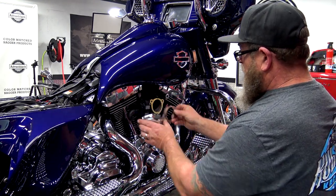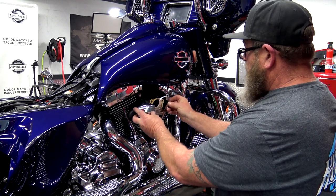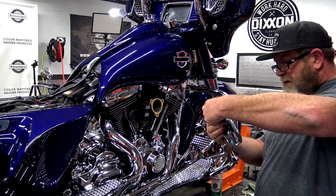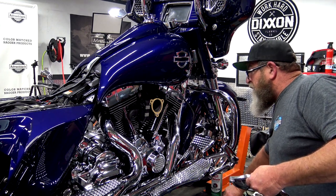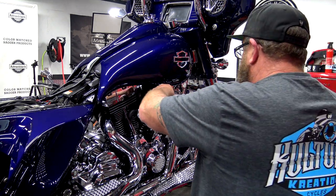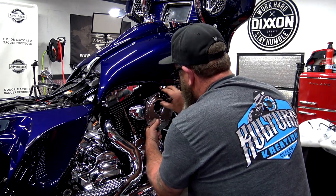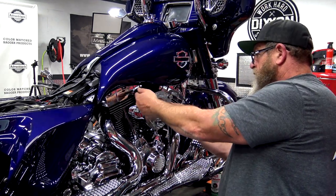So this goes on like this and I can't see anywhere in here where we're going to need our spacers. I'm just going to assume this is going to mount up right there. Let's try to line all this stuff up because that gasket is not sticky at all. I'm going to line this up on my backing plate, try to get one of my bolts in there. When I get this thing up there, hopefully I can get this one all the way in. You definitely have to have that gasket in there, and I have to make sure my gasket is up in place. Get our banjo bolts started with our spacers in there.